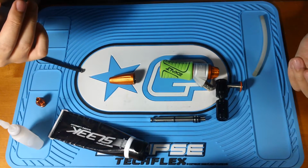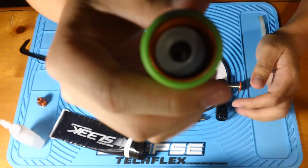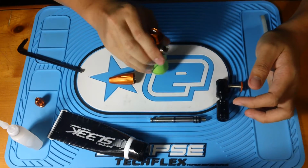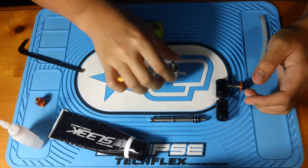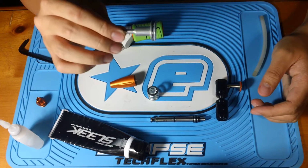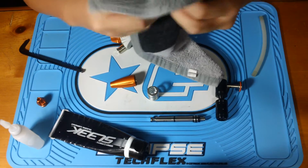Let's go ahead and we'll go backwards. So start with the HPR. If you look inside, there's a giant piston. Just give it a little tap. Maybe sometimes a harder tap, but I got a little Eclipse pad, so it's alright. The piston and the spring come out. The spring's really simple, not as complicated as the older shim stacks. So you take your piston, take your towel, and wipe it down.